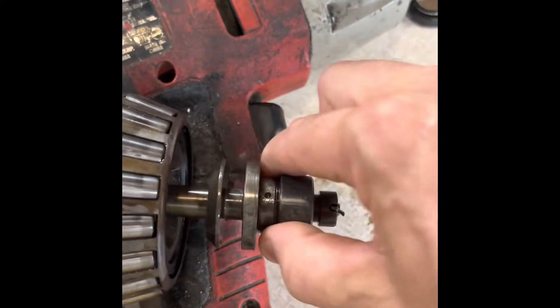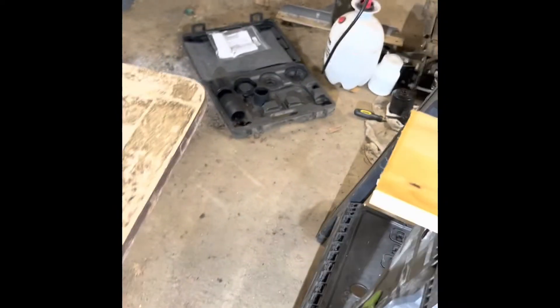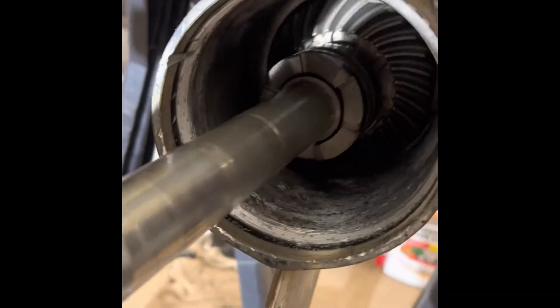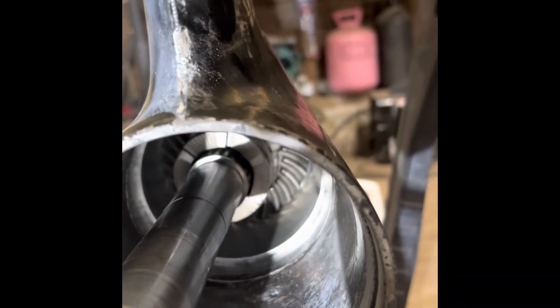If you get it in here, it will act like it works because it will still pull this back and forth. But this is what you want engaged - this is the shaft that has to go back in. If you turn around, grab this shaft, you're going to tilt it at an angle, put it in, and make sure it engages that shift shaft. The way you know it engages: if you can turn this up here, you can see that system right there moving back and forth. You're messing with the shift shaft up top and you can see it moving - that's how you know it's in proper position.